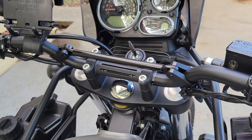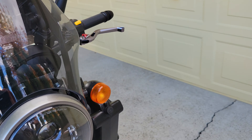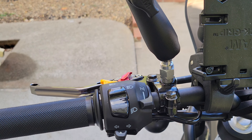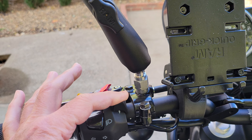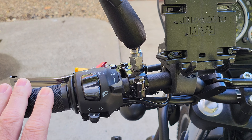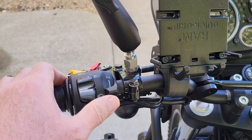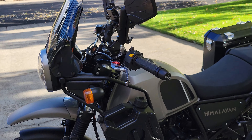I went with the aluminum Royal Enfield handlebars, which is pretty slick. For some reason these handlebars are slightly a larger diameter than the originals. If you notice here, this is the little starter bypass — notice how when you slide it down it stays down, because there's friction from a little plastic that rides against the handlebar. So it's a nice feature: I can flip it down, it'll stay with the choke on, and once it warms up I can slide it back up.